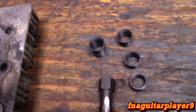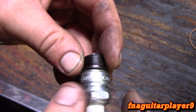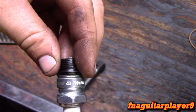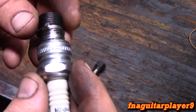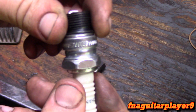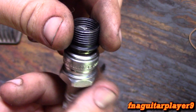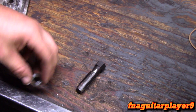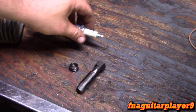I got the shortest one here. Make sure your spark plug is the same thread — that's exactly what you want. If you go with one that's too long, it's going to be sticking down into the combustion chamber and could hit a valve or a piston. Since I've got this shortest one, that's what we're going to use. Let's go ahead and get the head set up and get ready to start threading.